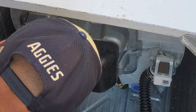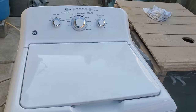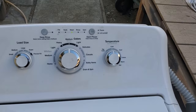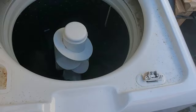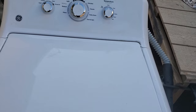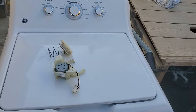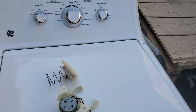Let's go ahead and give this a test run. I've hooked the washing machine up to my test station and a load of duct tape delicates is underway. It's already progressed to the wash cycle — there's no weird grinding noises at all. This is a relatively inexpensive fix: the spring and the clutch can be found for about $30, and the shifter-actuator can be found for about $60. So for around $100, you could have a working, non-grinding washing machine and prevent yourself from having to go out and buy a new one. If you find this video helpful, make sure you give it a thumbs up and stay tuned for more videos.